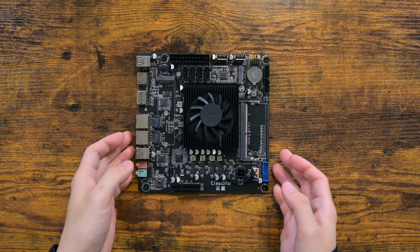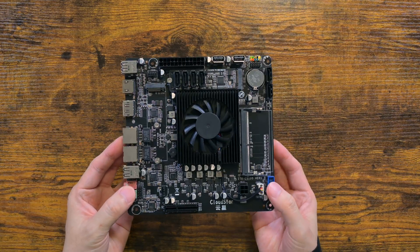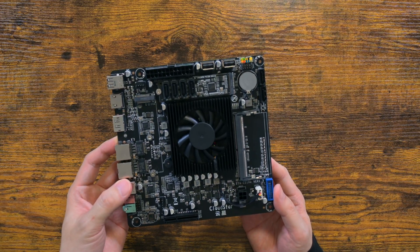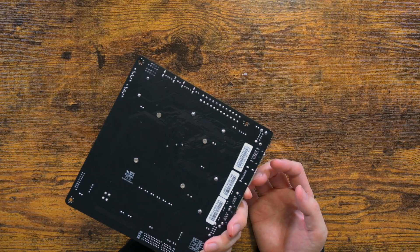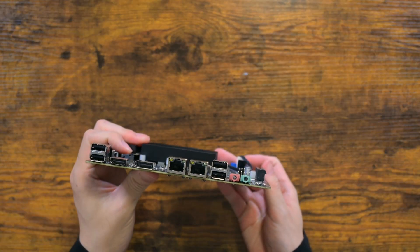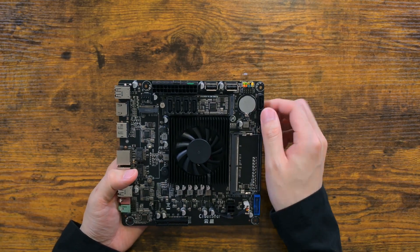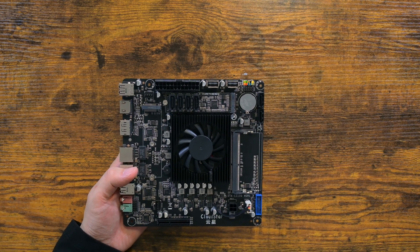Hello and welcome. This motherboard was found on Alibaba, and it advertises itself as a NAS motherboard. As you can probably see, they didn't exactly lie. However, you can probably tell that they are pushing it. Instead of native SATA ports, you are seeing a pre-installed NVMe to SATA adapter. I feel like this is sort of cheating, because any motherboard can turn into a NAS motherboard this way.